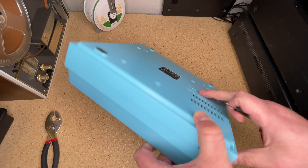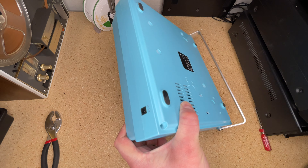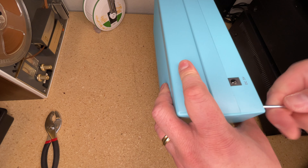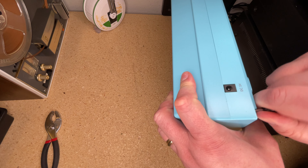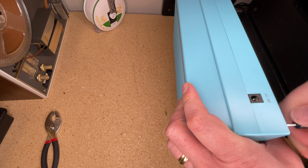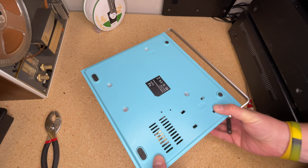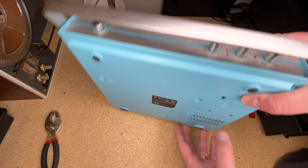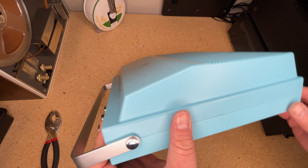Apparently the design has been modified significantly. A lot of companies — if I give them feedback like 'okay, we'll let our R&D people know' — you wonder if that really happens. With these guys it definitely did happen, and that's what other users of these products have told me. It uses a clamp system to apply downforce pressure on the stylus. There are different settings, but it was basically putting way too much force down. We took the clamp and adjusted the setting so it wouldn't do that.